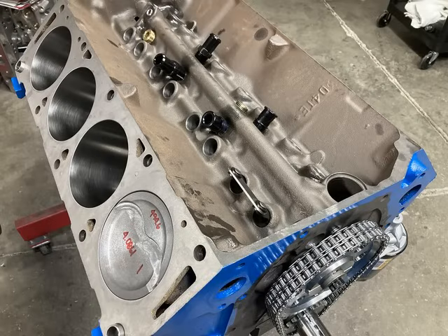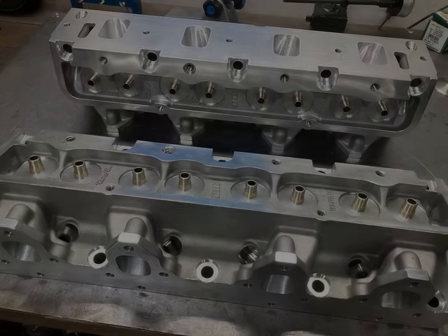There's another shot of the assembled short block. Cloyes billet steel timing set, BAM lifters in there. We decided to go with a solid roller, since the car won't be driven very much at all — it's a D4TE block, later model. Not many miles to be put on it, so we weren't really afraid of lifter longevity. The solid roller helped us make the horsepower, but with the advertised durations it was small enough to keep the overlap down — only 61 degrees of overlap on a 109.5-degree lobe separation angle.